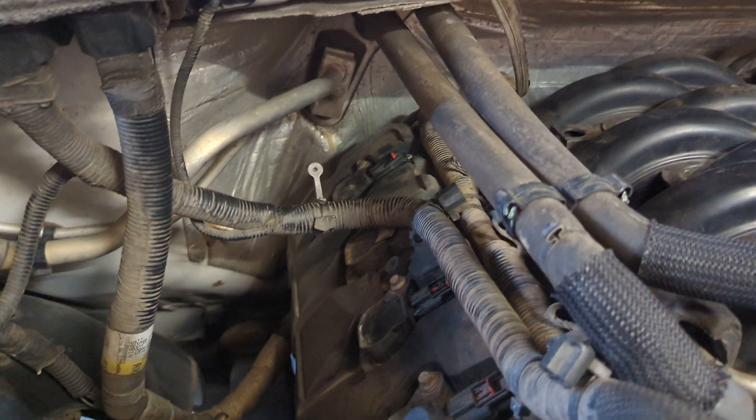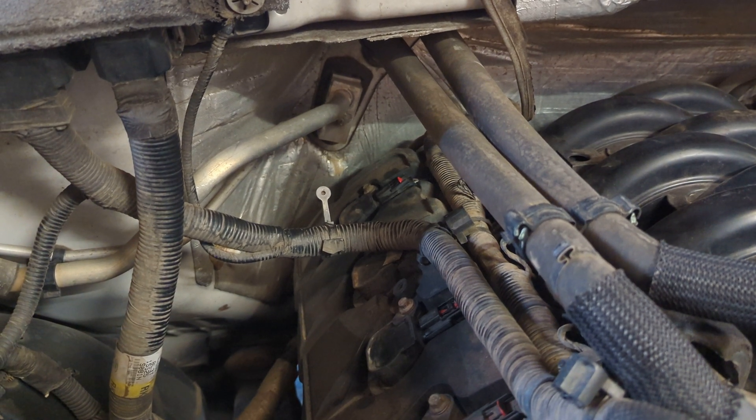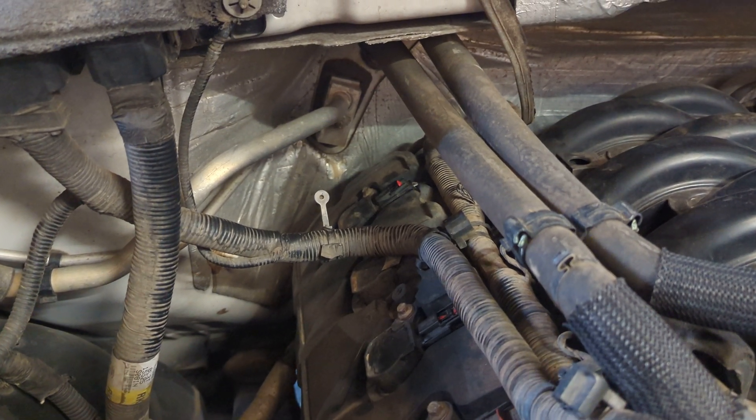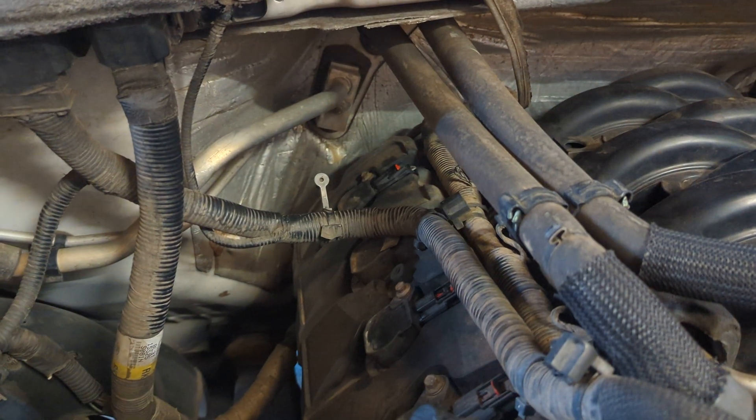This one had a busted spark plug that was really worn out — the porcelain was broken on it — so I don't know if that played into the factor or not. But I have just now confirmed that it is the intake valve that is causing the issue.